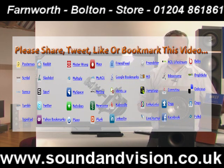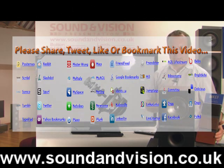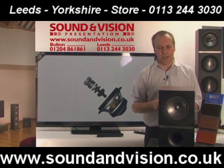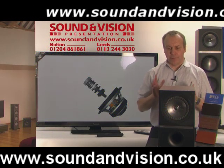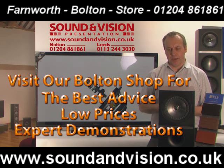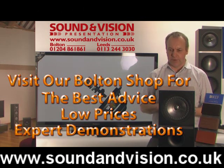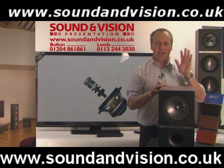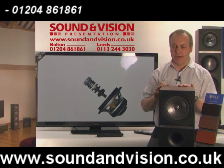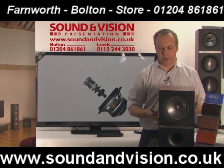They're available in three different finishes, which are Black Oak, Walnut and Cherry. So let's have a look at some of the design technology in this new range of speakers. It is a complete rework from the old KEF IQ series. We've gone back to square cabinets, because you can get 30% more volume of air, so you increase the bass from the speaker.